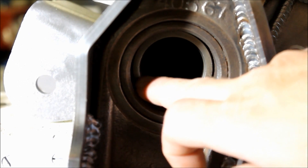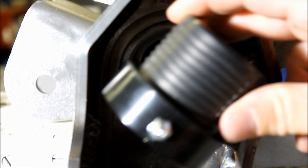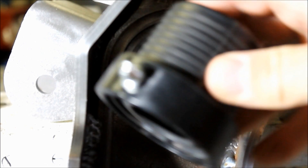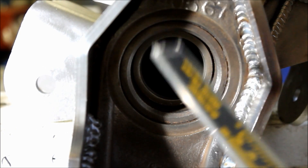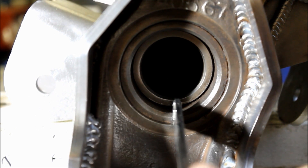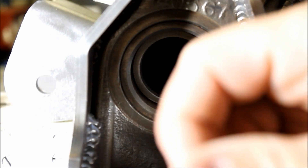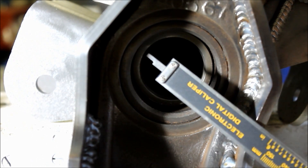Now, you'll recall that I put the Ironrock Off-Road Interaxle Sleeve Kit in the Overlander's Front Dana 30. That created a little bit of a problem when I wanted to install these aftermarket outer axle seals because, as you can see, they're supposed to go in the axle tube for about an inch and a half. However, I did still have about a half-inch shelf in there where I think I could make this work.